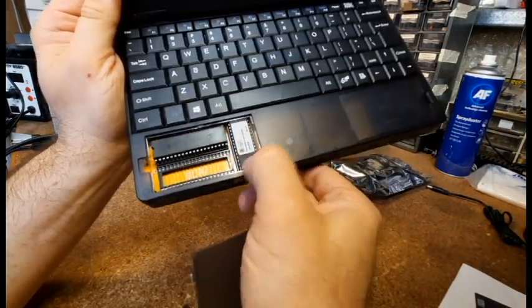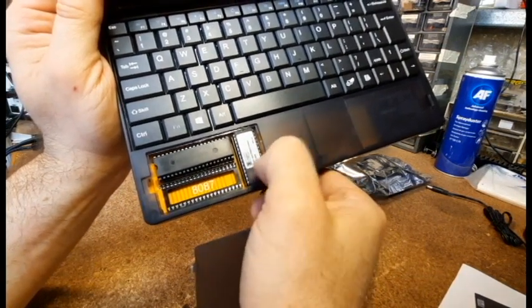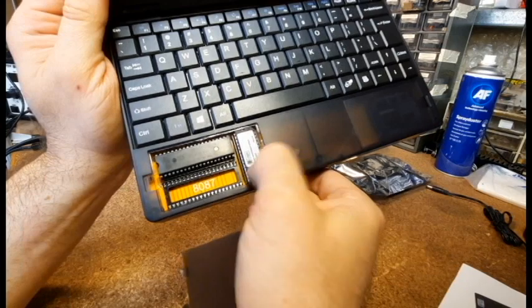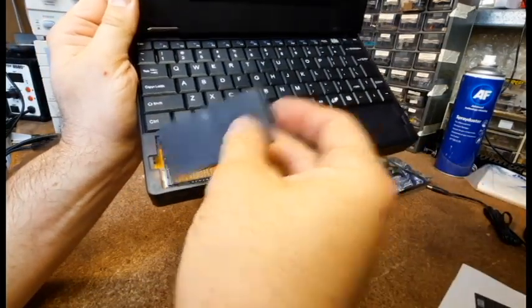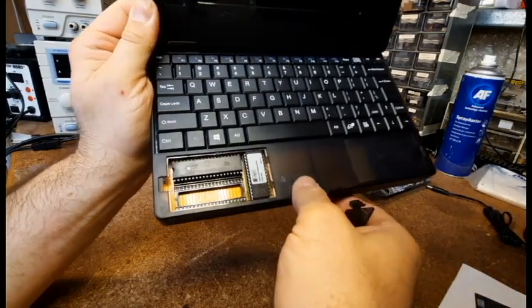It's fine. And the BIOS chip, which I will be replacing. I'll either reflash this one, or I will be taking this original one out, which is probably more likely, actually. Buy a new chip, program it, drop it in here. From a look on Sergey Kiselev's website, he's actually made a custom BIOS for this little laptop, which is quite nice. So I'll probably load that on.